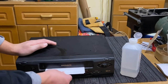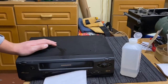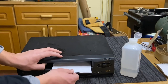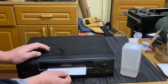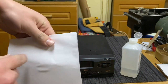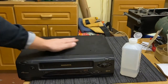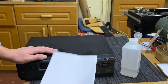Move left to right — it's really one direction, left to right. What that's doing is rubbing alcohol on each head back and forth, getting all around the heads. Make sure you don't wet your paper too much because it will start falling apart, and you don't want paper fibers that could scratch the heads.